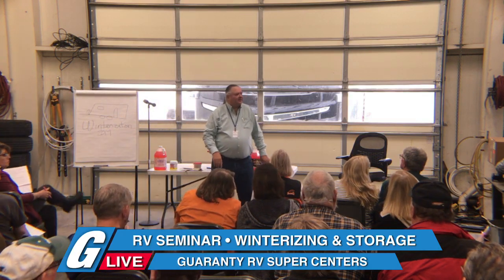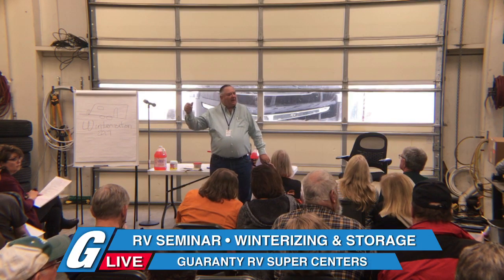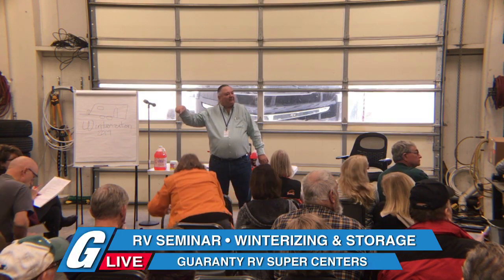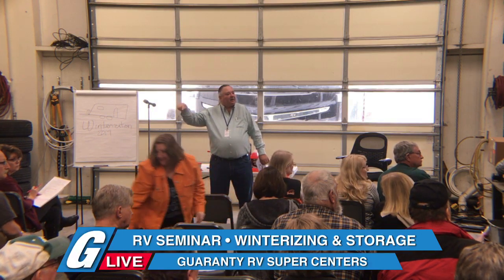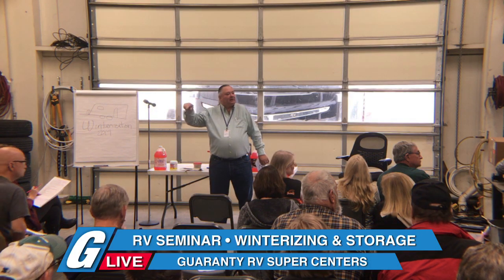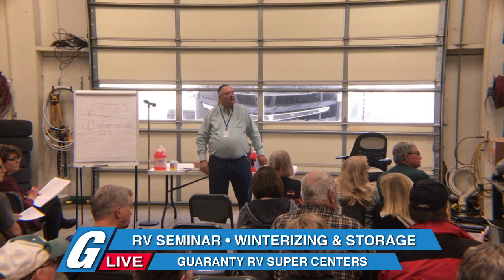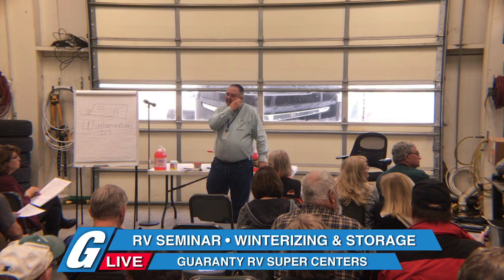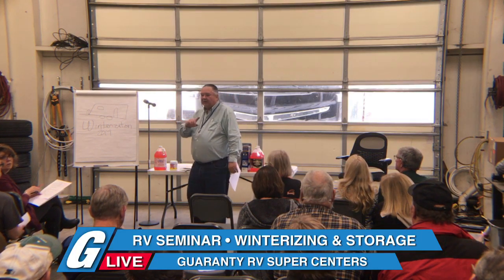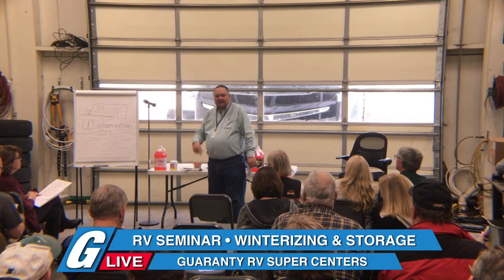Ted, when we're doing an ice maker on a refrigerator, do we unhook the line, or do we just hotwire the valve and unhook the water line after the valve? I hotwire the valve, but I put a 5-amp fuse in it so that it doesn't burn up the valve. I just energize the valve and blow air through it until the ice maker cycles. So that way I don't have to take anything apart. He's master certified, he's the best one we've got. Anything he says is true.